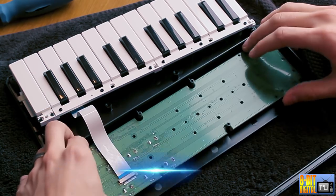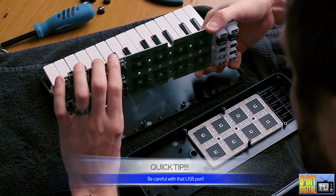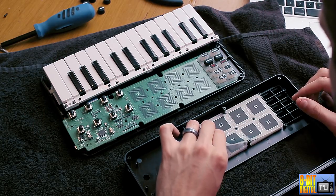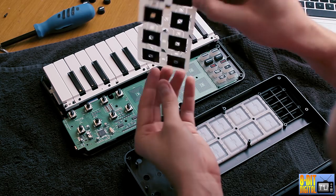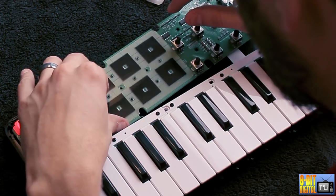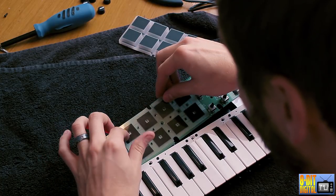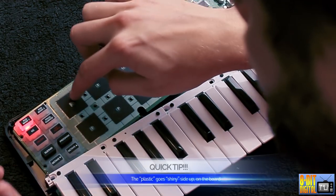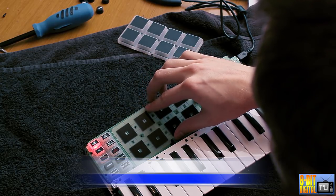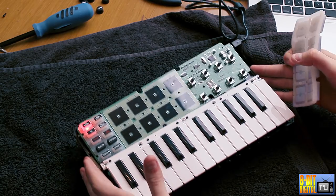Once you remove all those screws you can take the board off. Make sure you get the USB module out of the way. Right there is where the pads go, there are the knobs, there are the program buttons and everything. Take the pads off — there is a little piece of plastic right here. Here are the pads and how they light up. This piece has to be on there and it only goes one way. If you have it the wrong way they won't light up, so take it, flip it around — it completes the circuit and you'll have your lights.